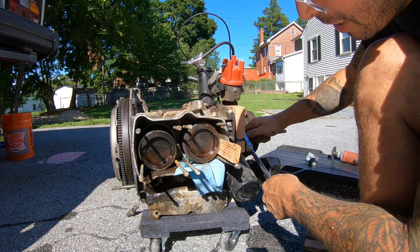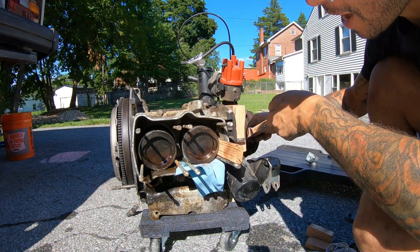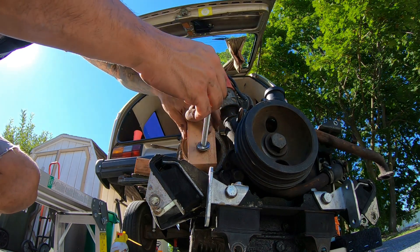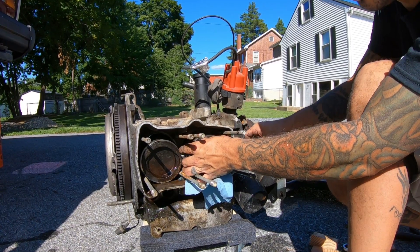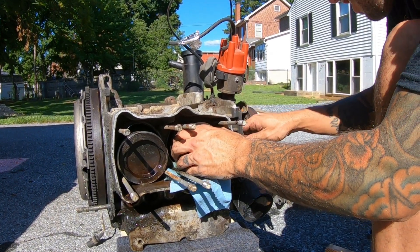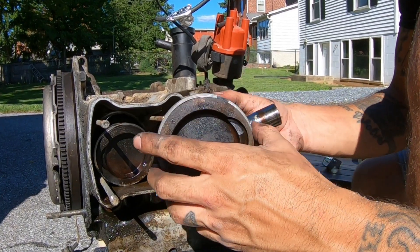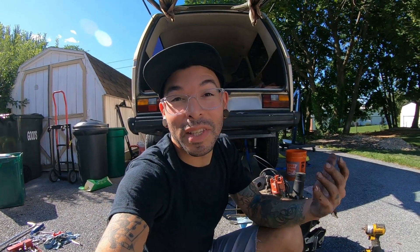This is the most progress I've seen in I'd say a little over an hour. I think we got it — yes! Back this all the way out. There's the wrist pin right there, and there's my nut that I put on there — it was just small enough to make it past the circlip and the exact size of the wrist pin. Now I slide this slowly, slowly, slowly — yes! There it is — our first piston. It actually worked! Oh I'm so pumped. Now I gotta do that about three more times and we'll have this engine torn down.